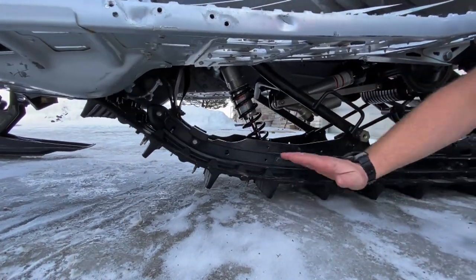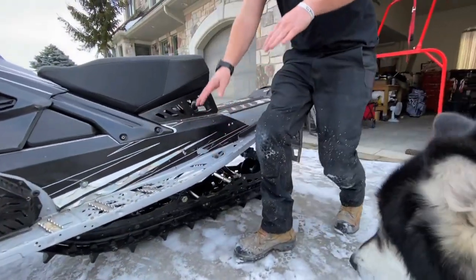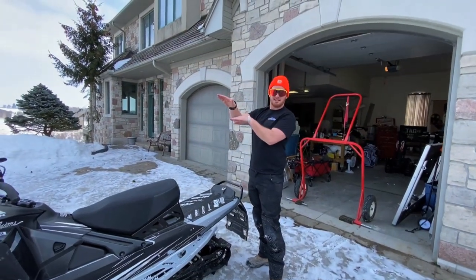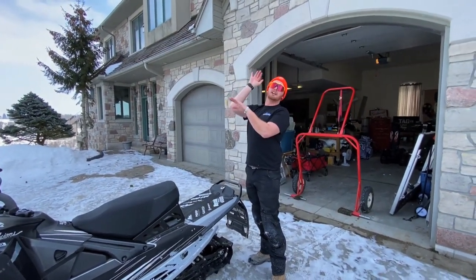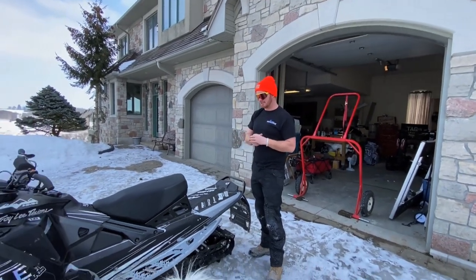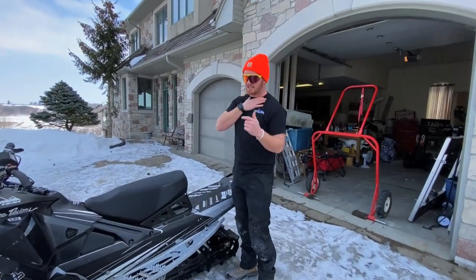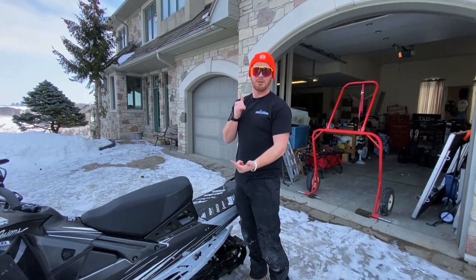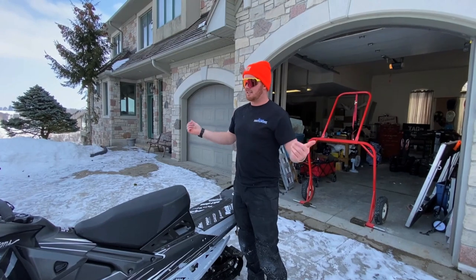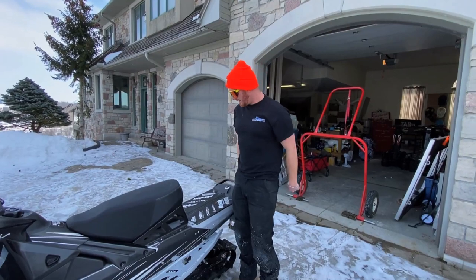So basically you have more lugs on the ground at a time. It just drops the skid down like that. It grabs a lot better and it wheelies a lot better. Puts less pressure on the skis probably. Exactly, less pressure on the skis. I'm sure there's a million different ways you could do it, but that's my first tip: loosen off your straps, find the right snow. You could put a higher riser on it too, to get more back in your standing position.